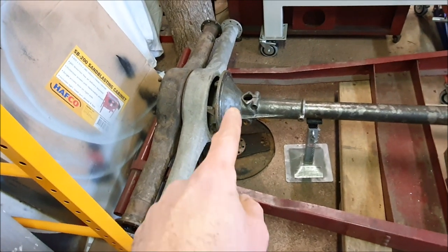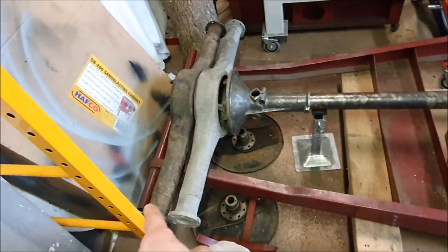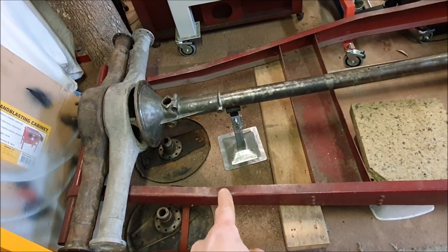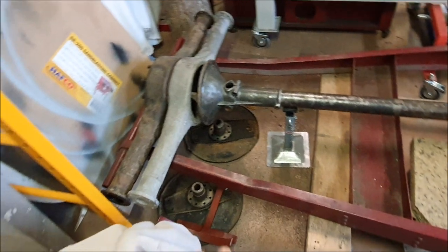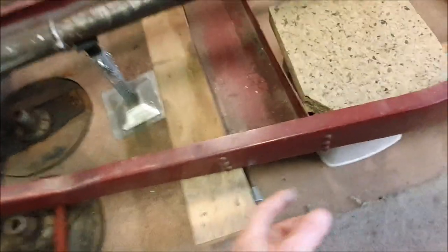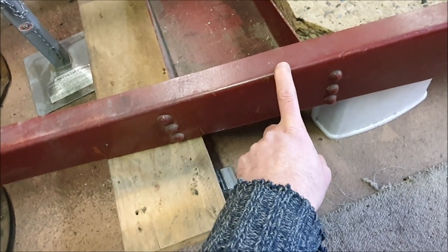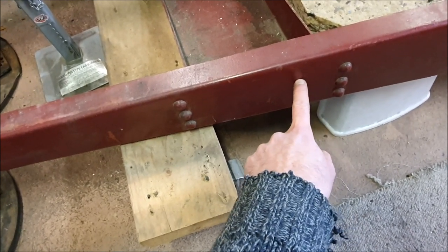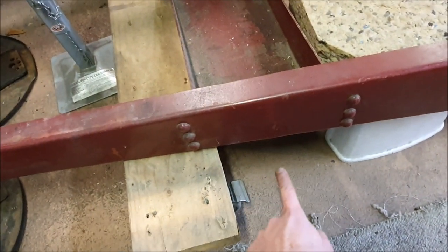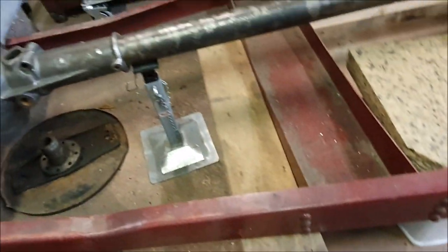You can also see from this how little room there is in the car. This torque tube runs alongside you and it's sitting on springs at the back, so this thing goes up and down with a tunnel over it. You can also see how in this case the torque tube is too long - the rear axle will go, with the spring running from about here to this bar at the back, so the middle of the spring is going to be about here. You can see how much the torque tube needs to be shortened. I'm going to wait until I've got the springs and work out the mounts for the rear and front.